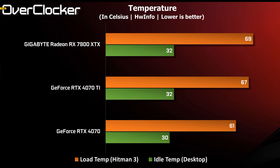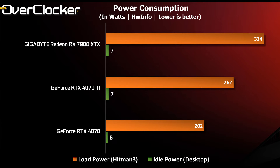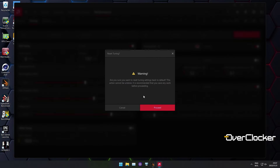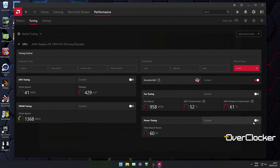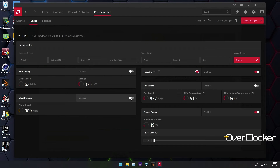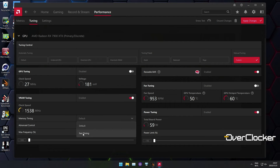Finally, temperature and power consumption under gaming. Keep in mind I'm using the quiet profile here, but even then 69 degrees Celsius is quite respectable. Power under gaming sits around 325 to 327 watts. The 7900 XTX can draw significantly more when overclocked, but I'm not willing to exceed the default TBP. You can undervolt the GPU to create thermal headroom for higher clocks while keeping the power limit the same or even lower — essentially reducing power while gaining better performance, which helps if you're on battery backup, as many are in South Africa given the electricity challenges.